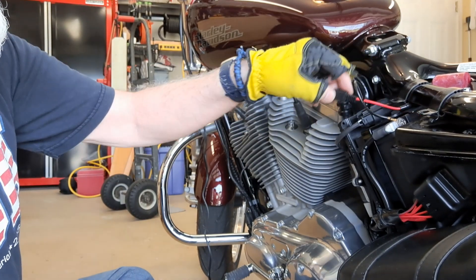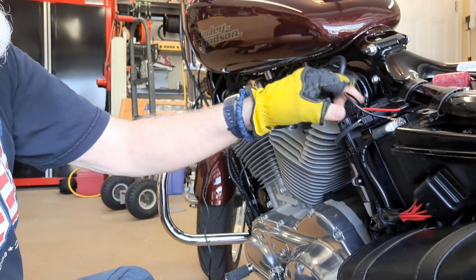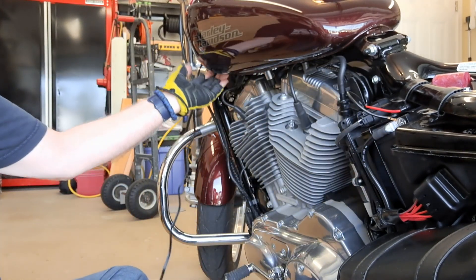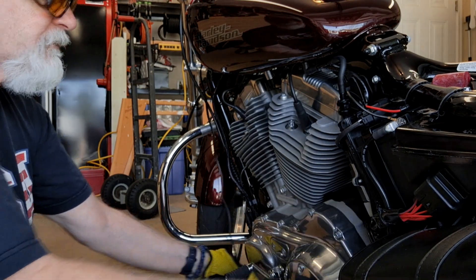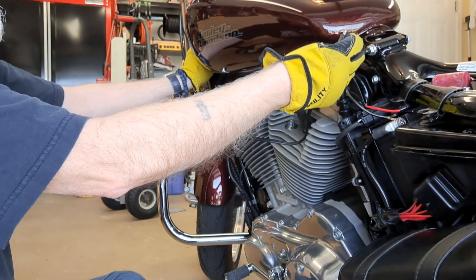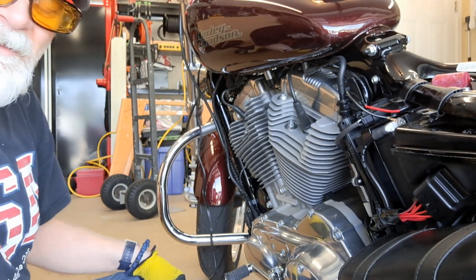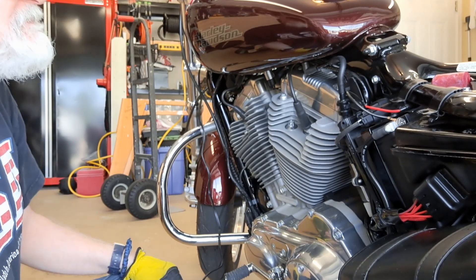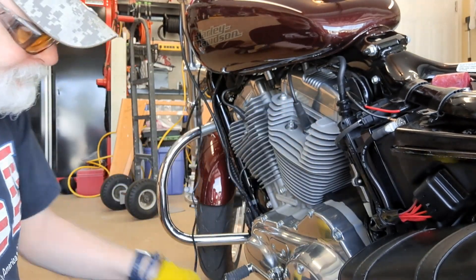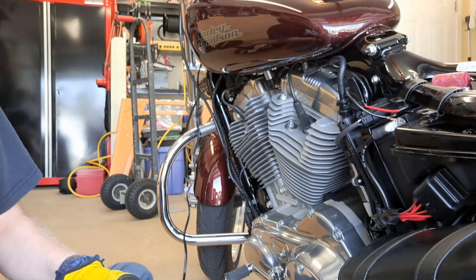Alright, making a little progress. I decided to change up the wire — put it underneath this part of the frame rail and reconnect the ground. The wire has to run close to the gas tank. In fact, it's too short to run the way I originally wanted, so I'm going to have to run it up here snug to the gas tank. Online it says 'easy install' — yeah, well, not so much. But we're getting there. It works, and that's what I'm happy about.